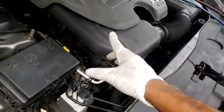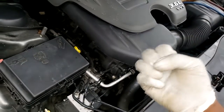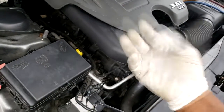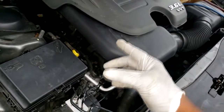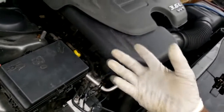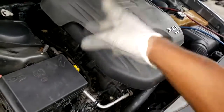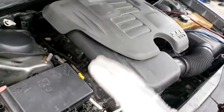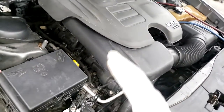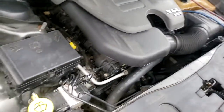Well, this took 1.5, so hypothetically if this car was towed in or came in with no AC, and we recommend an AC system service, you're only entitled to 1.5 or 1 pound of Freon during an AC service. So likely I would have put a pound of Freon in it and some AC dye, and did a real good visual inspection with my light in hopes of finding a leak. Some leaks are extremely slow to where it wouldn't show up.